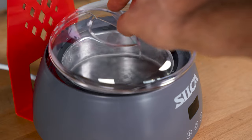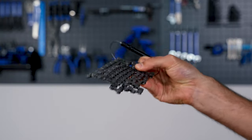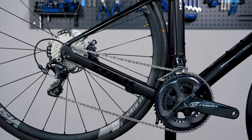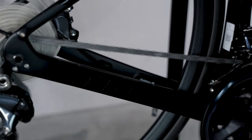You can simply close the lid and leave the wax in the pot to dry and reuse again whenever. Once the chain has dried up it will be rigid, so before putting it back on your bike, loosen up the links with your hands. Pop the chain back on your bike, and after a few pedals you'll notice a few wax flakes fall off onto your frame — this is completely normal and you can simply wipe or blow it off.